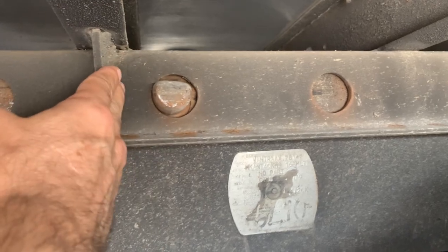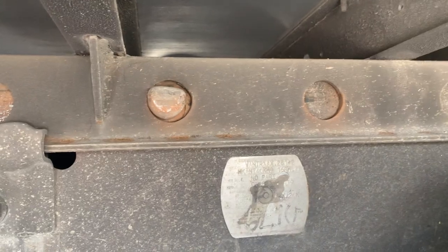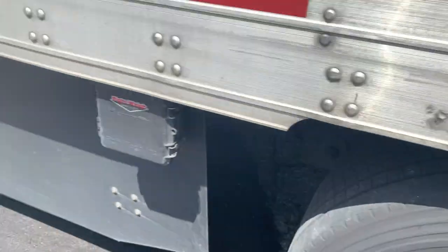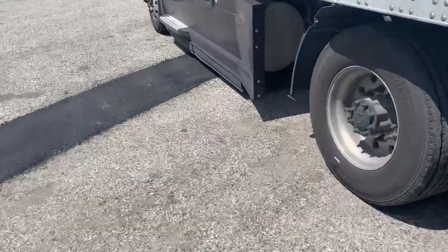This trailer was just shifted just a little bit this way. If there had been a gap on both sides it would have pulled in by itself. But what you can do is check the rear one out — same thing. A lot of times what you can do is go back into the truck and rock it just a little bit. I don't mean rock it hard — leave the trailer brake on.